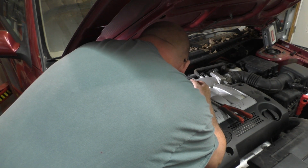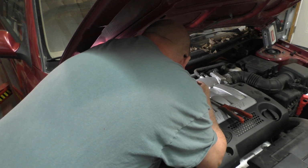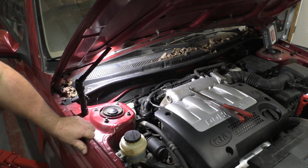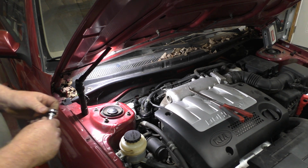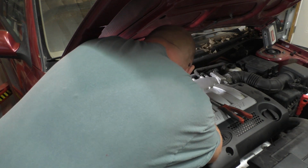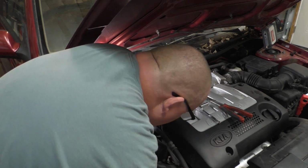Okay, there is a red and a brown. Brown wire needs to be verified on this. Make sure that part of the circuit is actually functioning correctly. And as I've already mentioned, we've already did this. This alternator here is simply bad. That's all there is to it. There's no in-betweens. I know, I do apologize. I'd like to get done with this one.